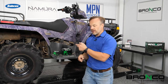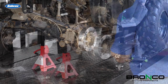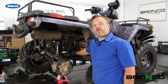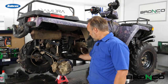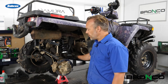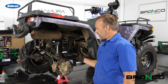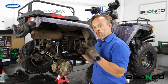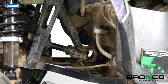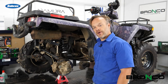We are going to dive into the rear axle on this. We've pulled the tire off, and we're going to pull this rear prop shaft. This U-joint up front is loose with a lot of clunking going on. In order to do that, there's no way to get the shaft out without moving the rear differential back a little bit. So the first thing we want to do is knock those roll pins out, then take the differential loose so we can slide it back a bit, and then pull the drive shaft out.